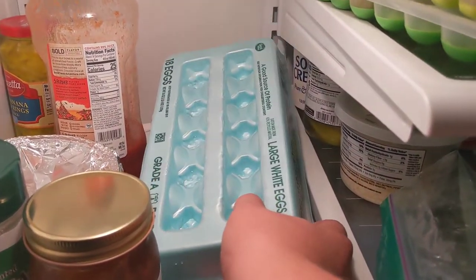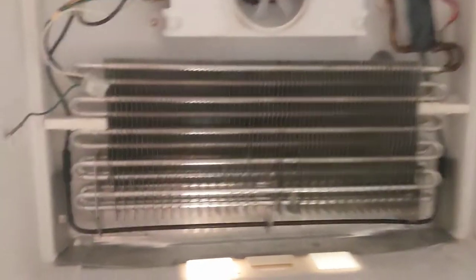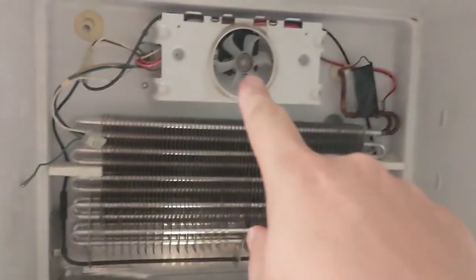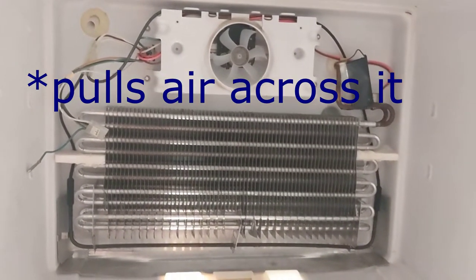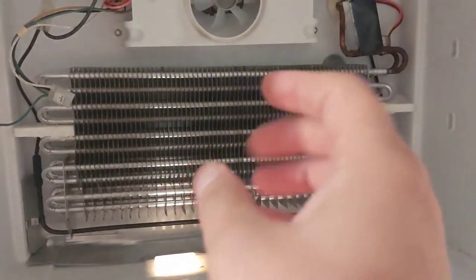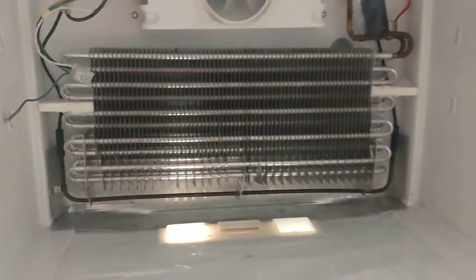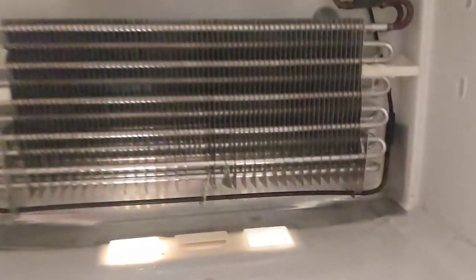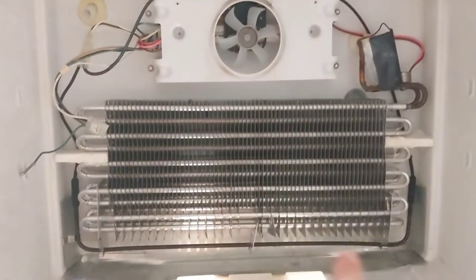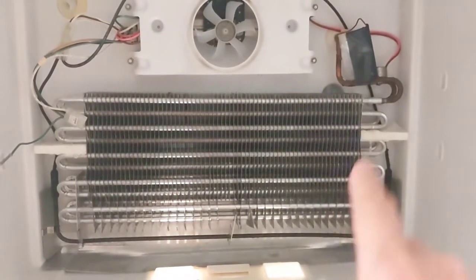The situation is there's an issue in the freezer, but your symptom is you're getting water in the fridge — like there's water on top of your eggs. The issue is in the evaporator. This is the part that gets cold. There's a fan that blows air across it so that it chills the air inside your refrigerator. Humidity builds up on the surface and will actually freeze up between these little vents so it can't pass air anymore. You've got a timer down here in the central unit that will divert energy from the compressor system to this electric heater system, controlled by this thermostat.